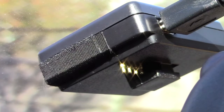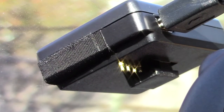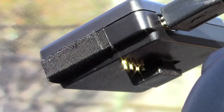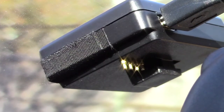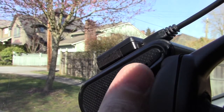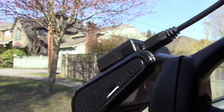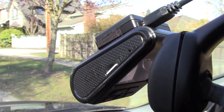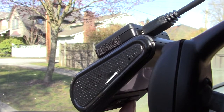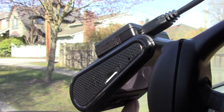This is all that you require to eliminate the shutter, the shake, and the intermittent GPS connectivity. This does not add or increase the gap to those gold pins for your GPS. This is simply creating an additional anchor point on both sides of your GPS mount to eliminate vibration. Now when you attach your dash cam to the modified GPS mount, it will get tighter and tighter the further down you go, and when it finally locks in place you will notice something remarkable — when you go to push a button, it actually does not move. Amazing improvement for such a tiny cost of tape.